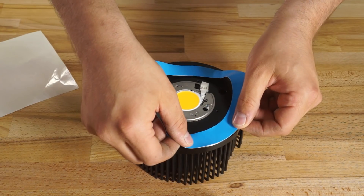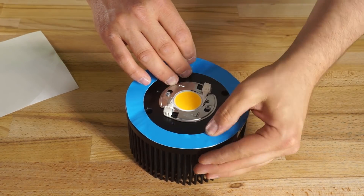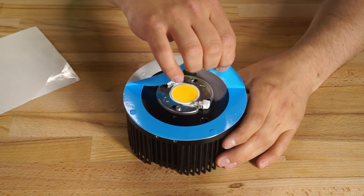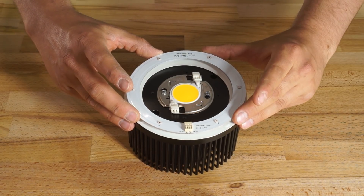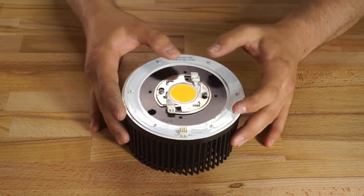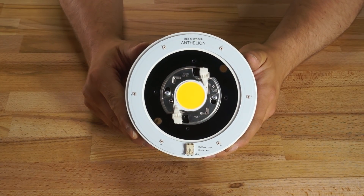To install mine, I applied the thermal tape ring to my 140mm heat sink using the outer edge as a guide and then threw the Anthelion down on top. The tape is going to stick out a bit on either side, but you can trim it off with a knife if you feel so inclined. Make sure to line up the outer edges of the sink and the thermal tape, because if you leave a little gap — as I did initially — your thermal tape isn't going to fit quite right, and it's super sticky stuff so removing it and reapplying is kind of tricky.